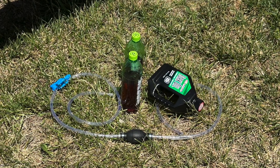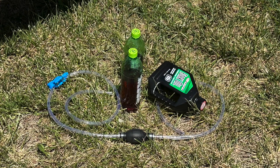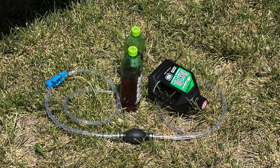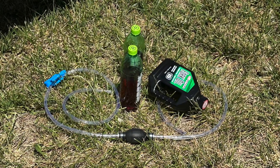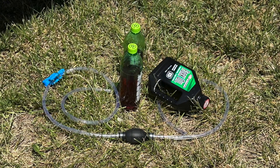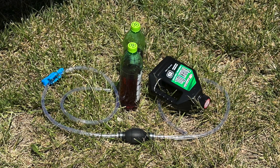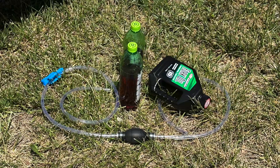Then we cycled all the slides and jacks three times each and re-leveled. It's been almost 36 to 42 hours since we completed that and we've had zero jack popping. I can give this two thumbs up as a good piece of maintenance to do if you're experiencing that sound — it really worked.